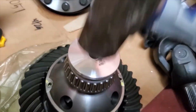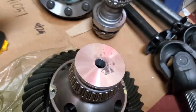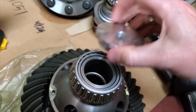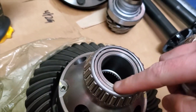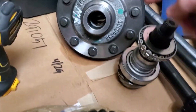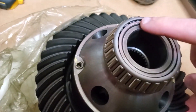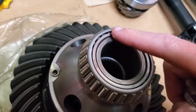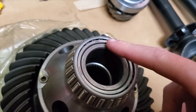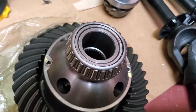When we flip it, you can see how it's moved down a little bit more each time. Just making sure it's seated all the way down. I did notice that this part of the ARB housing is designed differently than the stock housing — this lip is much larger in this direction from the edge of the housing. You're going to have a little bit of a lip, which I kind of like. This doesn't go all the way down as deep as it would on the stock carrier, but it doesn't affect anything. It sits right where it should be. That's about all I have for that side and we'll move on to the other side.